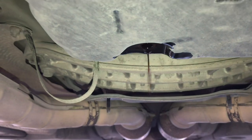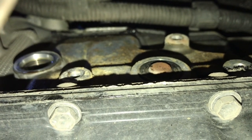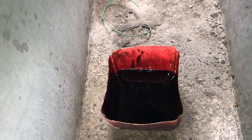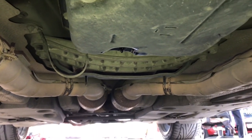This is what it looks like. So the small one is a 14mm and it goes right here — that's where you drain out the transmission oil. The second one is a 24mm and it goes right there — that's where you actually pour back in the oil, the transmission fluid. It's still dripping, so I'm giving it a little time to make sure I get everything out. You want the transmission to be running good, so just give it a little time. The car didn't get a lot of time to drain since I just parked not too long ago.